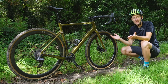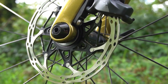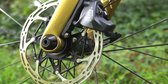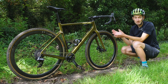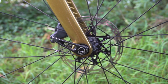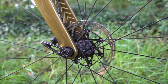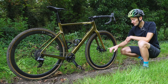We start our inspection at the front of the bike — in particular the dropouts — because this bike has a fairly unique trick up its sleeve: adjustable geometry. Adjustable geometry is not something we've seen much on drop-bar road bikes. Over in the mountain bike world it's very common, where adjusting geometry allows the rider to adapt the bike to suit their riding style and terrain — slacker or steeper to suit their requirements. On drop-bar road bikes we haven't seen much of it, but with gravel bikes now accommodating a wide variety of tire and wheel sizes, we've seen a few manufacturers play with fork offset. Cervelo have something called Trail Mixer — basically a two-position fork offset, with two positions forward and rearward with a five-millimeter difference between the two.